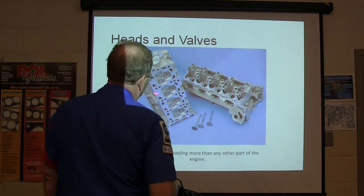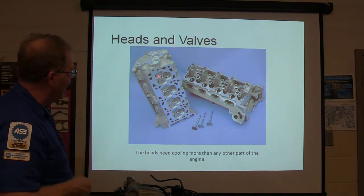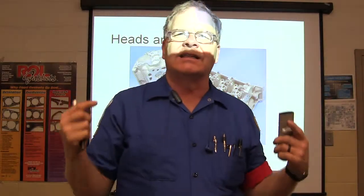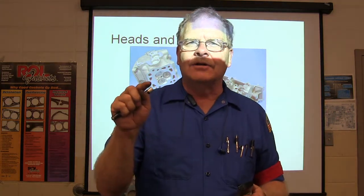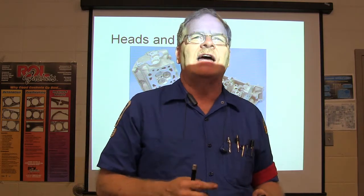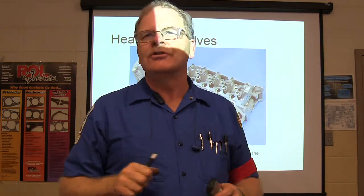All right. Heads and valves. These are three-valve heads off of Ford. The heads need cooling more than any other part of the engine. The head is the hottest running part. That's why on a lot of these vehicles now you'll see that they have a cylinder head temperature sensor. And on your Ford vehicles, the one that says Triton on the side of it, if it detects the engine's running too hot, it shuts off the explosions,